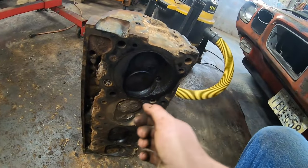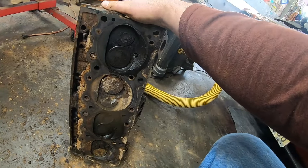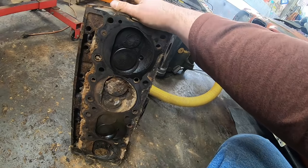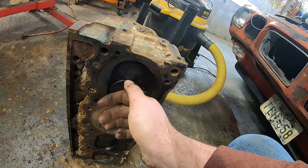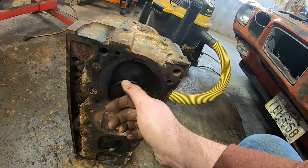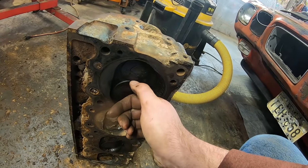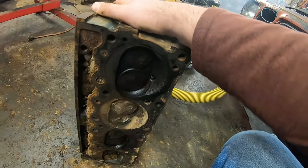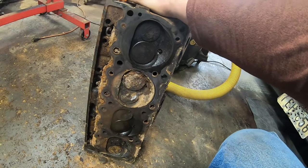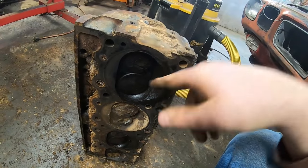Here's a swap meet tip for you. If you're looking at Pontiac cylinder heads, same thing goes for good small block Chevy heads. If they're a big valve head, just to help you eyeball them, if they're a 211/177, you should be able to fit your thumbnail in between the intake and exhaust valve, and just barely be able to fit it in there, because they cram those valves in there big time. Pontiac always had a good flowing cylinder head. That's a big part of it.